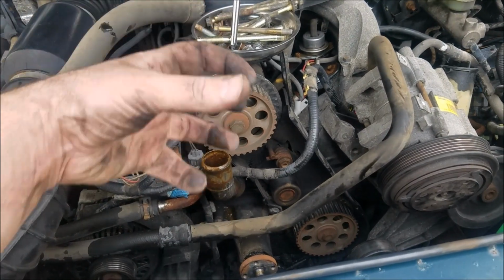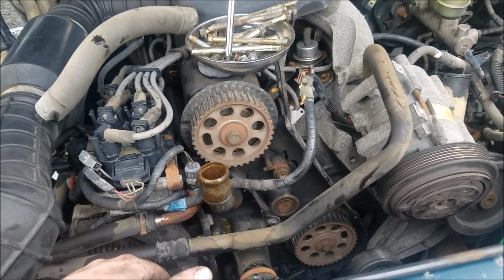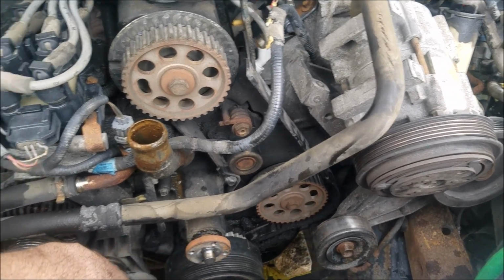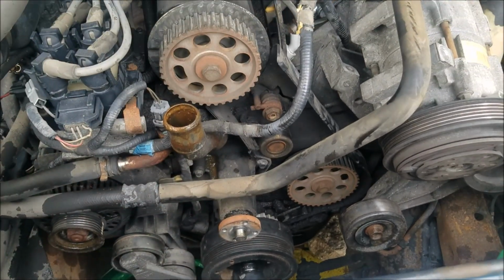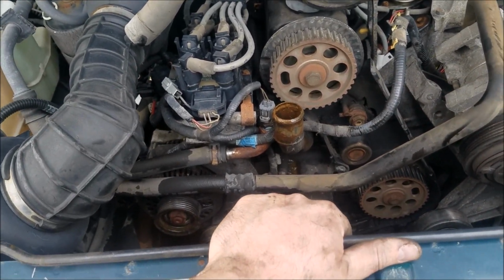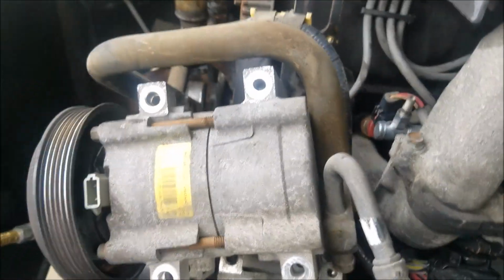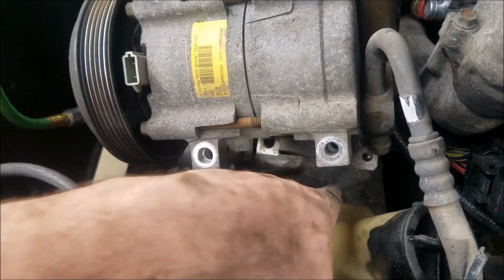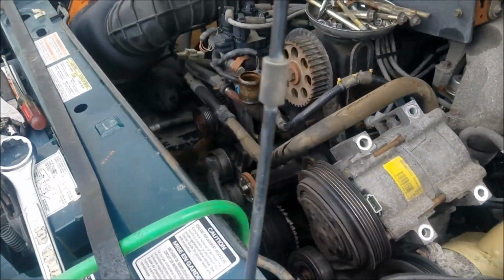I didn't film the tear apart process because it's seriously very straightforward and self-explanatory. You know, 4 10mm bolts on the water pump, pull the fan, everything off with the shroud. 2 10s to get the radiator out. The hardest part was on this bracket. There's a bolt underneath this guy. I'll show you when we reassemble. There's a bolt down there and a bolt right over there. Easiest way I got to it.